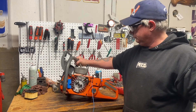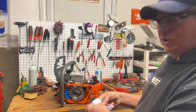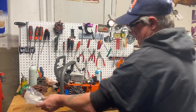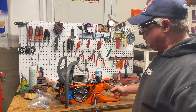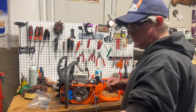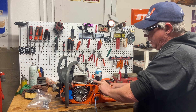This is the 390, by the way — for Tyler Hewitt. I put the non-rev-limiter ignition on it — the black one. The part number is 544-04-70-01. Some different models of Husqvarna have the same ignition but different part numbers. The rev-limiter ignition is a 13,000 RPM limiter — nothing wrong with that for a big saw with a long bar — but a lot of customers when they're on top of a big log limbing want the RPM. I rev 390s at around 13,600 to 13,800.